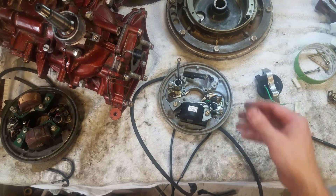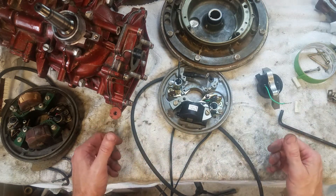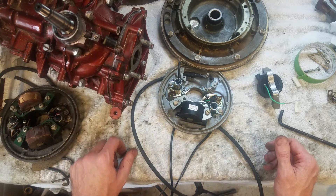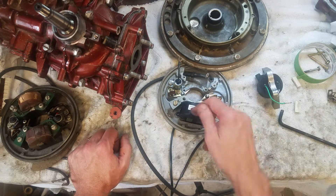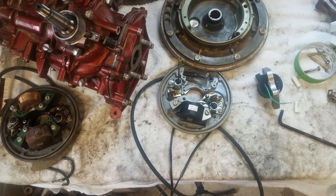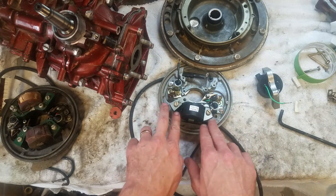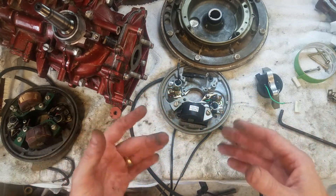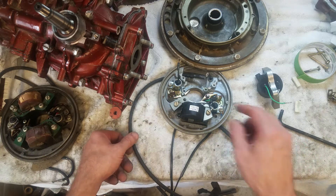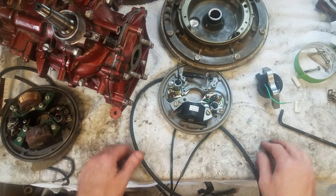The faster you turn it, the more it rotates above the block underneath the flywheel to advance the timing. This system doesn't require a battery to operate — it generates its own power through the magnet and the field of the coils. If you've got a problem with your ignition on an old magneto point system, it's going to be either the coil, the condenser, the points, or a bad connection — nine times out of ten it's a bad ground. Oil, film, debris, or corrosion can prevent the system from making contact, causing you to lose continuity and spark. But that's it: coil, condenser, points — one set per cylinder.